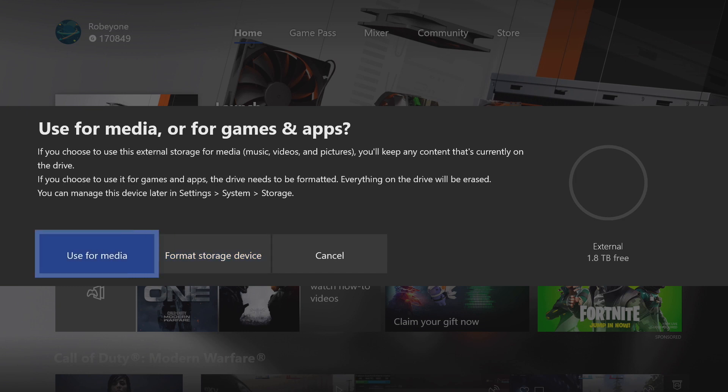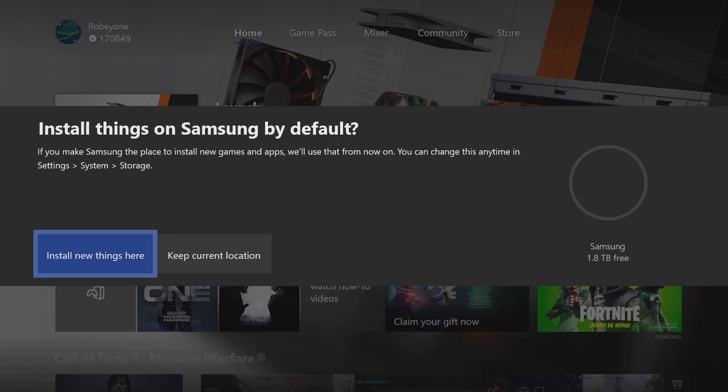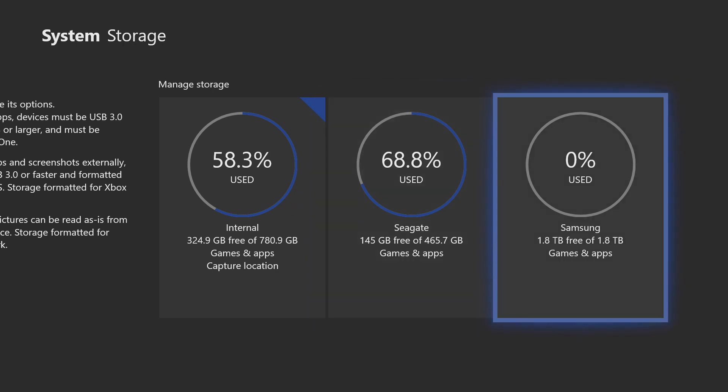Let's talk about setting this up. I'm going to use an Xbox One X here. All you need to do is find a spare USB 3.0 port on your Xbox One. On the Xbox One X there's one in the front and two available in the back. Simply plug this in and voila. Next, format your storage — make sure you do not choose the media option, choose the second option. Name it something good and easily understood, like 'fast external' or the drive brand, so you know what's installed where. Also, do not set this as your default installation place, especially if you're using a small 500 gigabyte drive. Be selective about what you install on it so you don't fill it up.